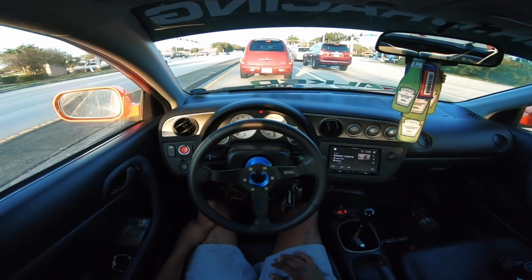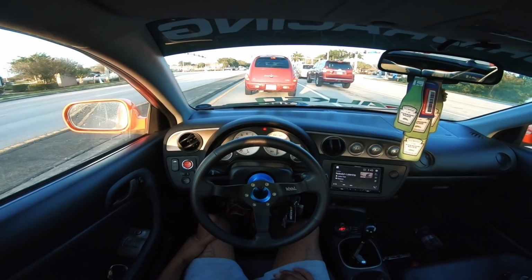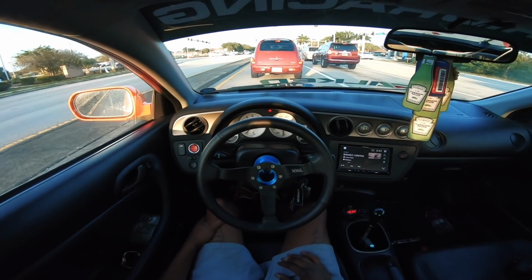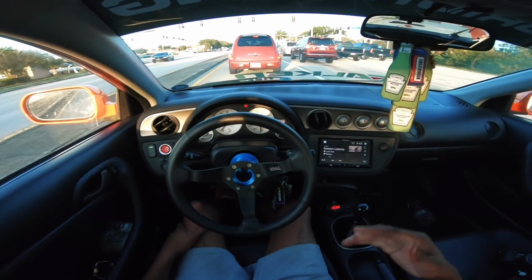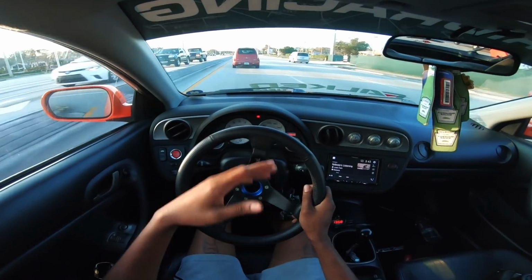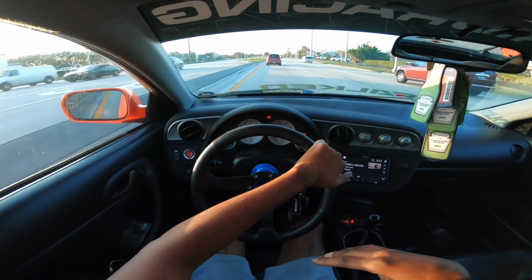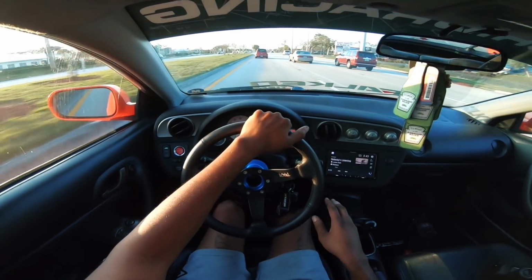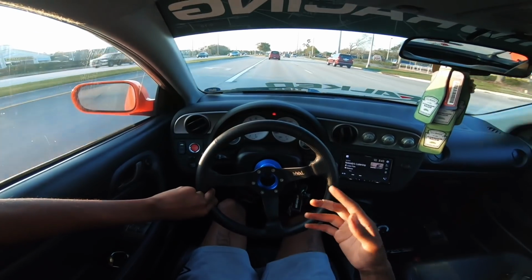That means you have more air than fuel, which means you have a lean condition where a fuel injector isn't firing properly. You're not getting enough fuel to compensate for the air. Let's say I didn't have K-Pro and I had a stock ECU with an RBC manifold on and full bolt-ons, then this number might be way off. I think it'd be lean because I have too much air to compensate for the fuel.